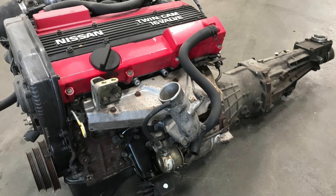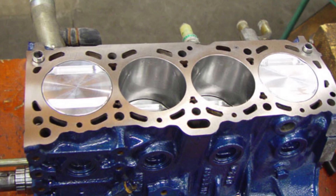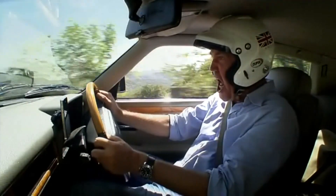Since we all know that these engines are great — or terrible — depending on where you are. The CA18 engine has several strong and weak points like many other engines. It has a cast iron block which makes it more durable, harder, and more reliable. It's belt-driven with a direct-acting camshaft, revs to the moon basically, and it's easier to modify — you can just slap an adjustable cam gear on it and adjust the power curve. In my humble opinion it sounds the best out of all stock S13 engines, not including JZ or RB swaps obviously.